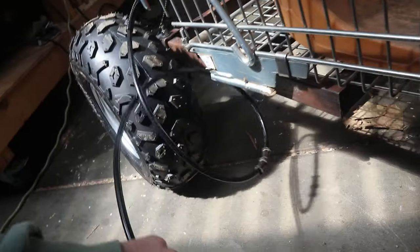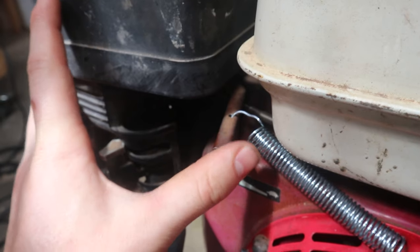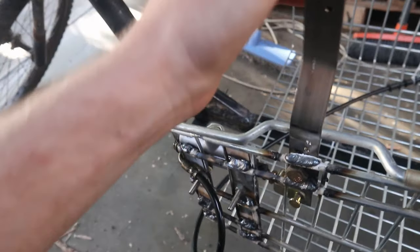Right now I'm trying to get the foot pedal for the brake sorted — the hydraulic cylinder. I also need to set up a throttle; I bought this spring and drilled it into the housing so it closes the throttle back — you don't want it stuck on full throttle. I got the brake mounted and was talking about doing a pedal setup here, but mum came in and suggested something easier to access, so I built this — it just pushes on the piston directly.